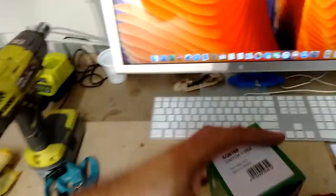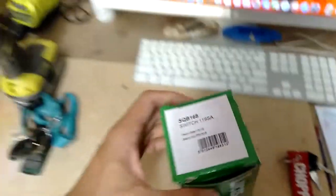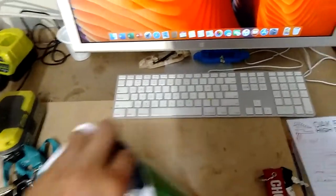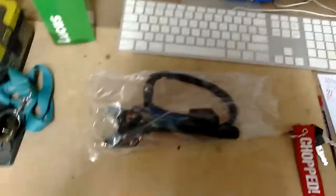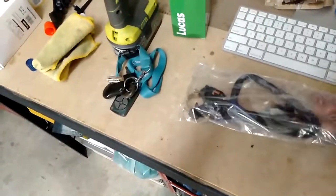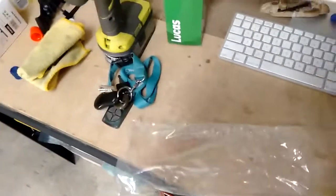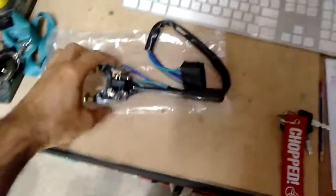So as I mentioned already, I'm assuming that this one is designed for a Leyland Mini, because I don't think the Mark II had this same switch, but I could be wrong. Because the Mark I switch doesn't have the facility for the high beam low beam switch. That's actually on the floor, but this is a lot cheaper to buy than the original Mark I, and plus I haven't got the floor switch for the high beam.